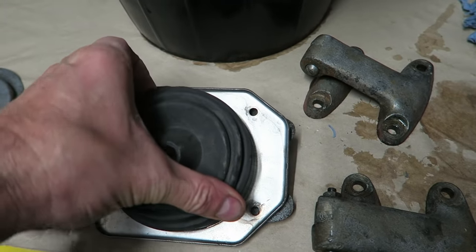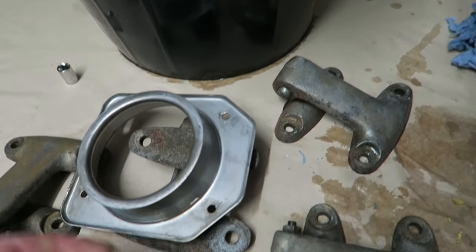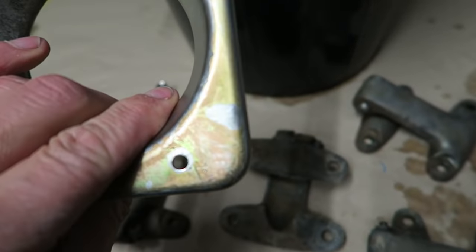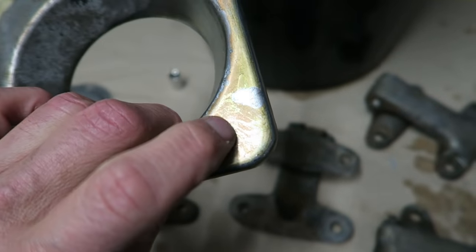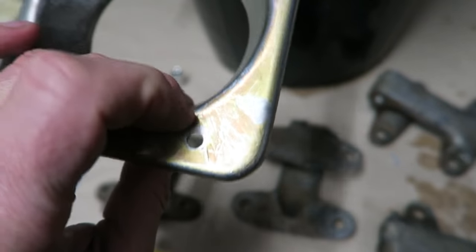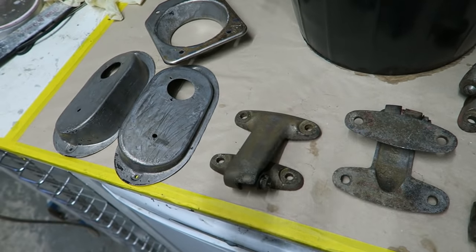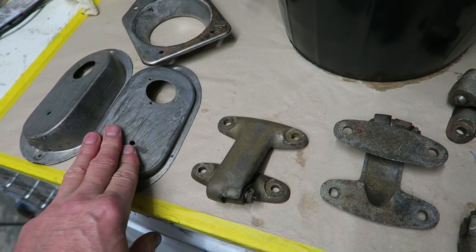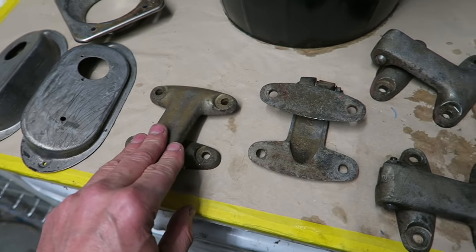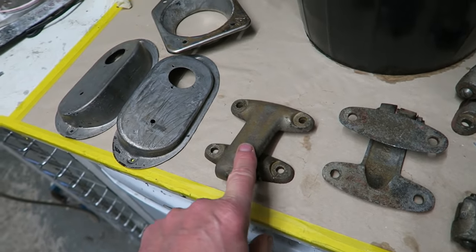I suppose this is some kind of, I don't know, show my complete ignorance here, some kind of zinc coating or something. Certainly not chrome. It wasn't chrome. It's greeny sort of yellowy zinc, zinky sort of passivate, is it called, or something, coating. So I'll put these parts back in for the second go. Normally give it a good three goes till it's completely got rid of all the rust. So I'm gonna put it back in, wash it off again, put it back in, wash it off, hopefully for the final time.